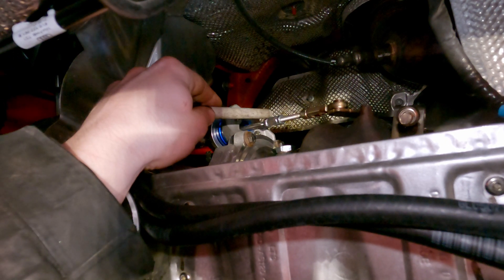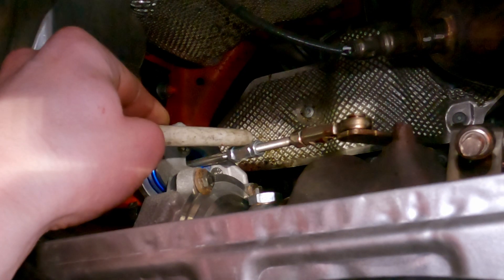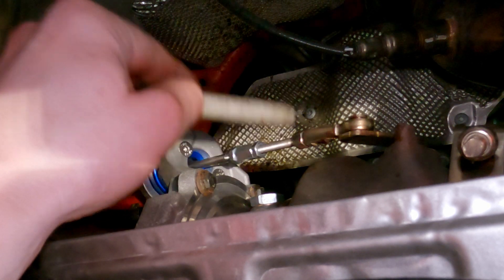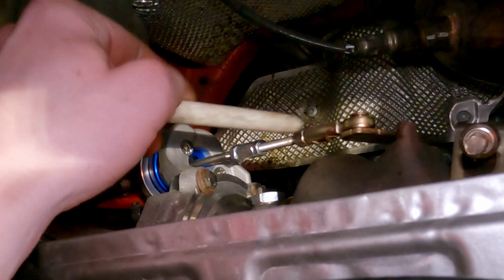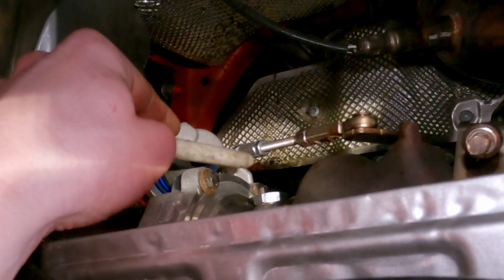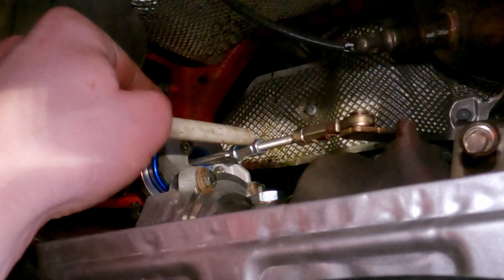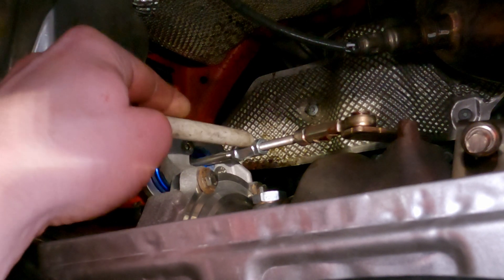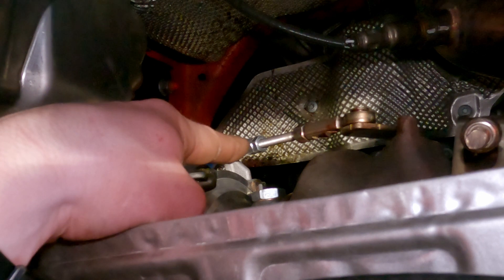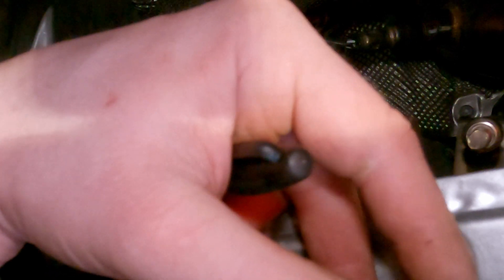This piece is just to extend the rod length. You get this on here — it couples to the threaded rod, and you get both jam nuts on. This middle section becomes your lengthening and shortening adjustment. You loosen the jam nut and twist it so that the full length just reaches the clevis. Then we go three full turns into it to preload the turbo, and that should allow it to crack around 16 psi — then it's properly preloaded. I'm going to put a marker on here and twist it counterclockwise three full turns to shorten the rod.